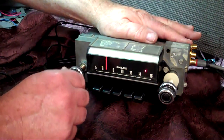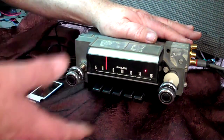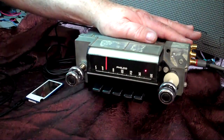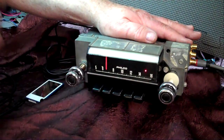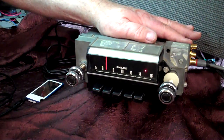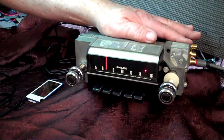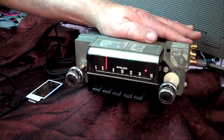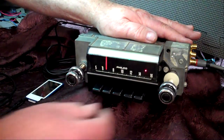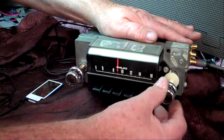Right now you're on FM and you have a status LED right here which is also for diagnostics. Every time you turn this radio on it runs a diagnostics on all the speaker wires and speakers itself. If it starts flashing red, you go back in your book and it'll have a two-code in it that flashes numbers - say one-two and then one-two-three - you look that up and it'll tell you what it is. If you've got a speaker shorted out or not enough power, it tells you what's going on. It will also change multiple colors for what you're doing. Right now it's on kind of an apple color - that's FM. Over here you have a stereo LED that changes whenever you hit a stereo channel. Those are optional, you don't have to have them, but a lot of people like them.